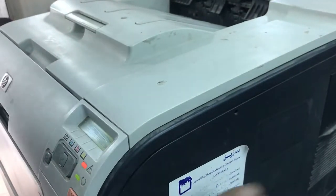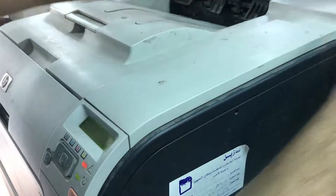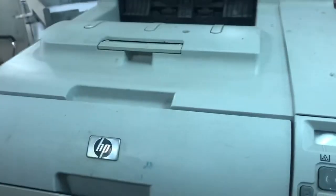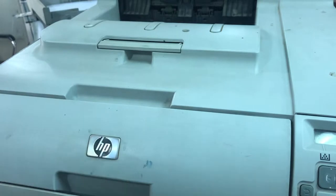Now you can hear the sound — it's rotated inside. Then turn it off again. I will show you the process. I will remove the power cord — there you go. Remove the power cord, then I will remove the tray. Now we will remove the pickup roller and clean it. This is the paper jam inside.